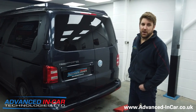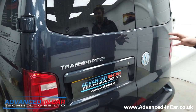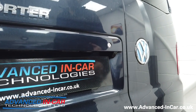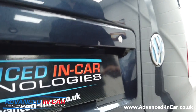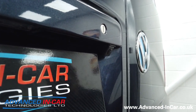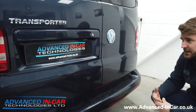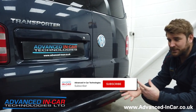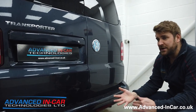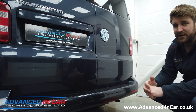Today's video shows a workaround with the VW T6s and a reversing camera, whether you've got the barn door conversion or the up and over tailgate door. If you want to use it with the factory fitted Volkswagen unit, you need to get in contact with us so we can check compatibility, because if your radio is the lower end spec model it will not be able to cater for a reversing camera.